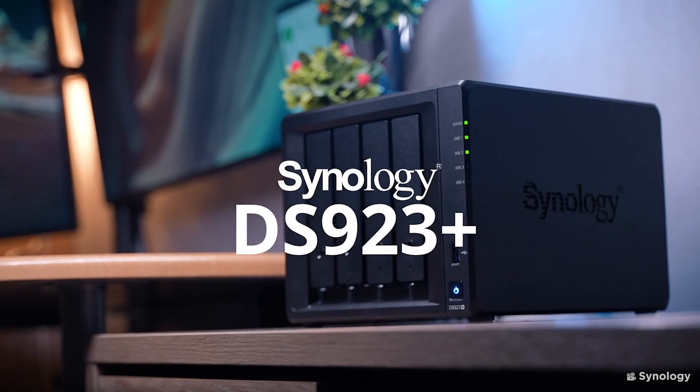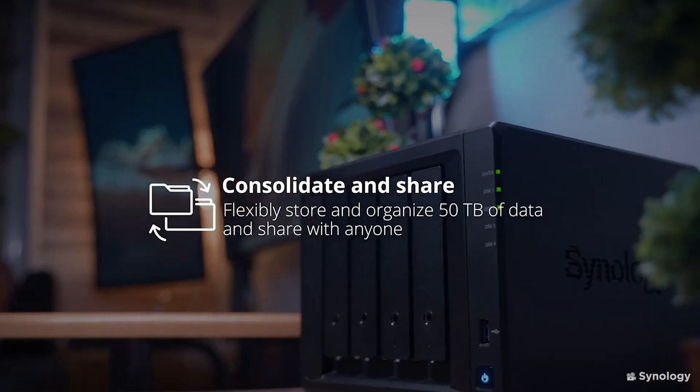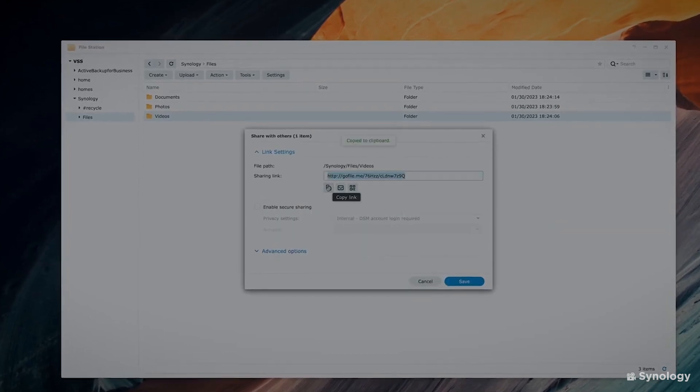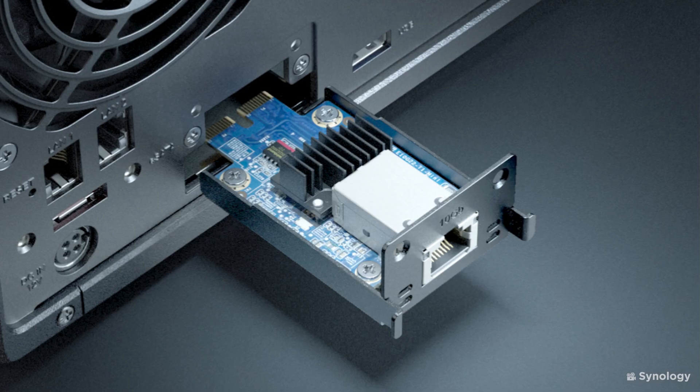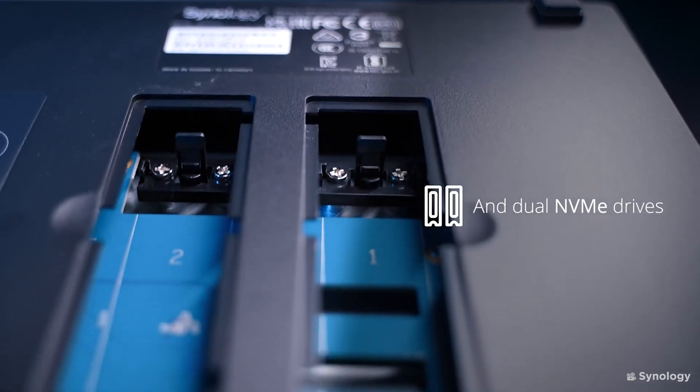This is the 2023 update to the DS920 Plus model from the last video — the DS923 Plus. This is a four-bay NAS with all the characteristics of the old DS920 Plus, but the 2.6 GHz AMD Ryzen R1600 now comes with 4 gigabytes of RAM instead of the old 2, and is upgradable to 32 gigabytes, which I highly recommend for multiple users accessing this NAS at the same time. Like the two-bay NAS, it doesn't have 10 gigabit ethernet built in, but it does have the ability via a PCIe card to have 10 gigabit connectivity, and it has those two M.2 slots for SSD caching or an SSD storage pool.